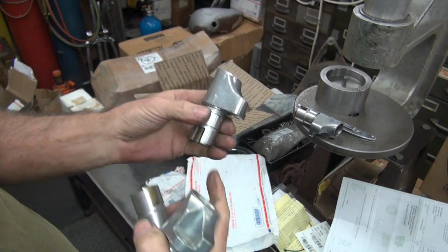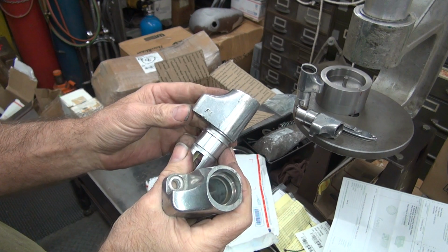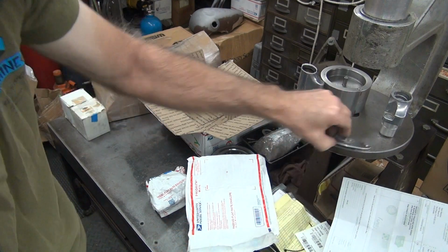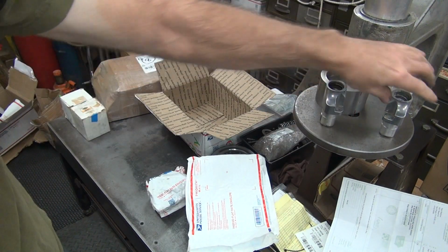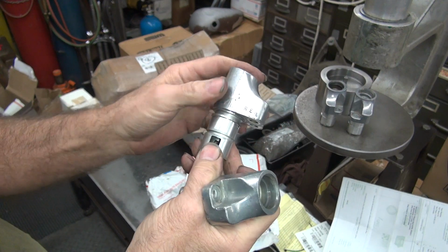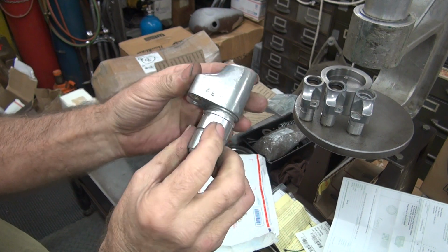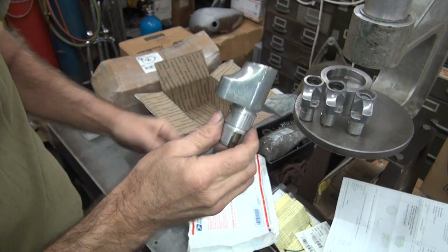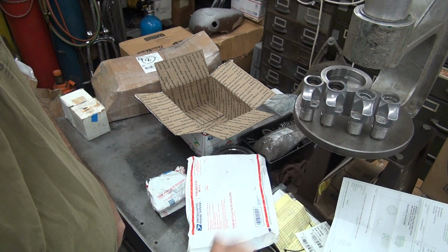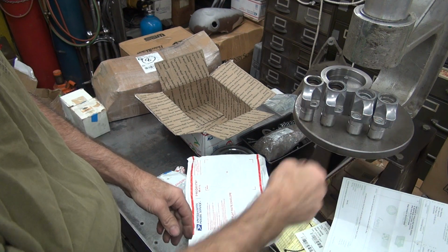So that's an RI. That'd be a rear intake. This is an FI. It'd be a front intake. So that goes like that on your motor. Rear intake, front intake. And this is a rear exhaust because RE. That means this should be an FE. FE, like Ford 390. There you go. And they go in pairs, look at that. In case they weren't marked, you would know the difference because that's how the bolts go together.